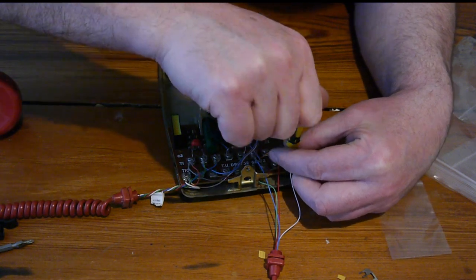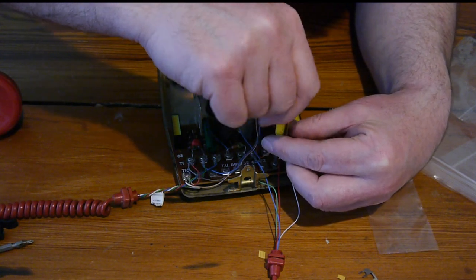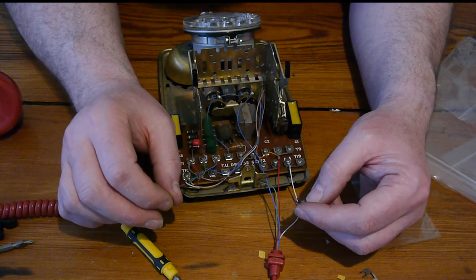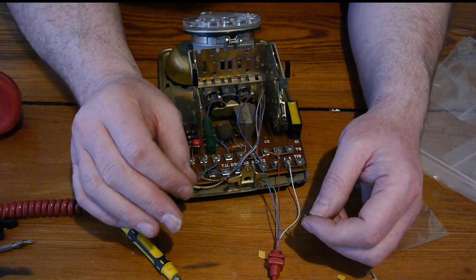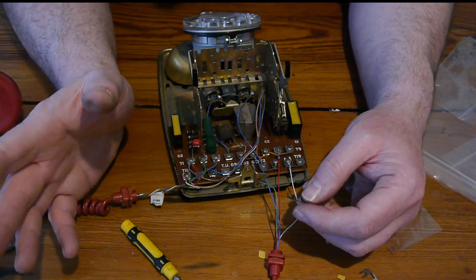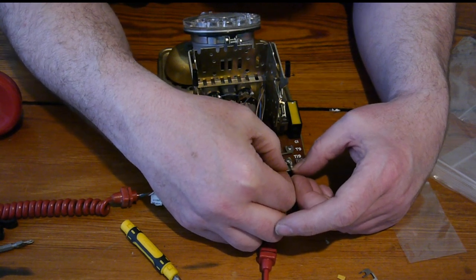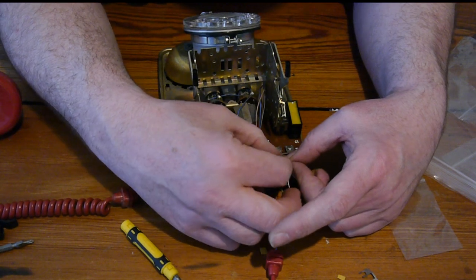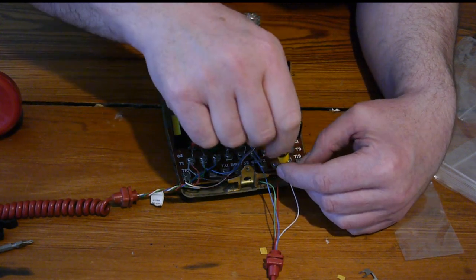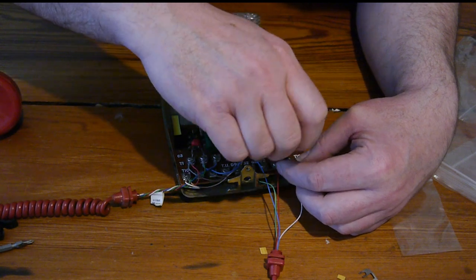This is the diagram I've been given for the new BT regulations. What you've got to remember is these phones are designed so you can have up to four phones on a line and different extensions. They're called REN 1. You're allowed up to REN 4 value, which is the ringer frequencies, the power to ring all four phones is available. And if you don't have these fitted properly, then the frequencies can play about with your internet and broadband. This is why they created the new phones. They don't want them to play around. They want them perfectly working fine.